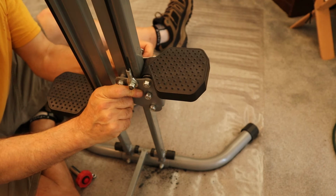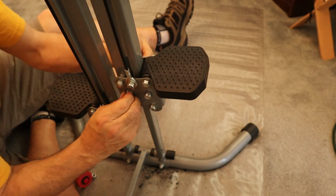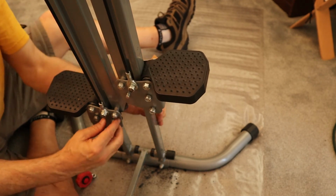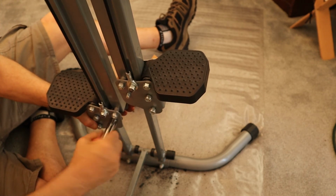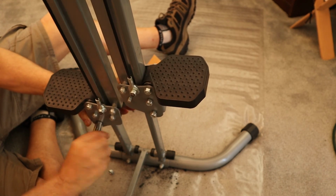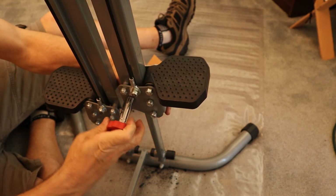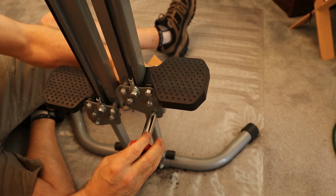It's always better to just relax and go with the flow rather than forcing it. So I haven't forced any of these. The other key thing is not to over tighten the nuts on these when you put them on. They have lock nuts. It's been a long day. This ratchet just paid for itself. I'll put a link down below. It's been a couple of years since I bought it. And you can see why you go with the deep socket. It just makes it so much easier.